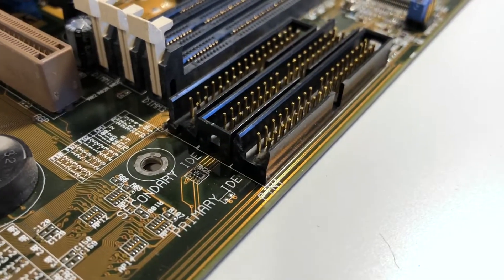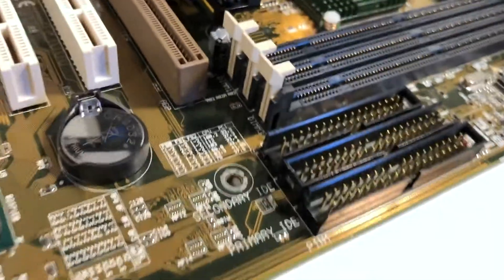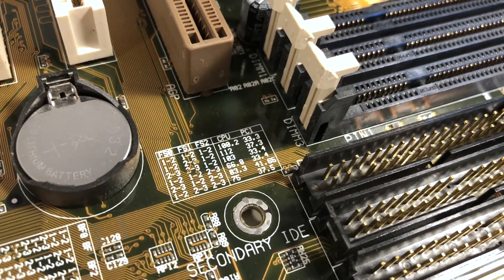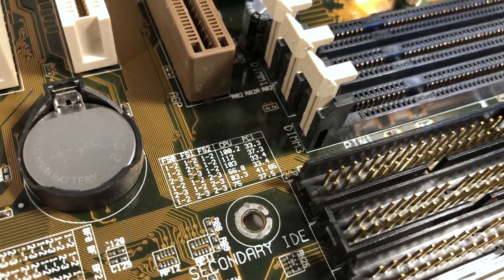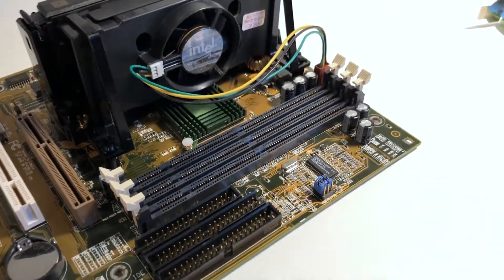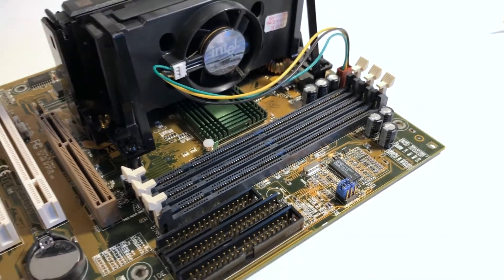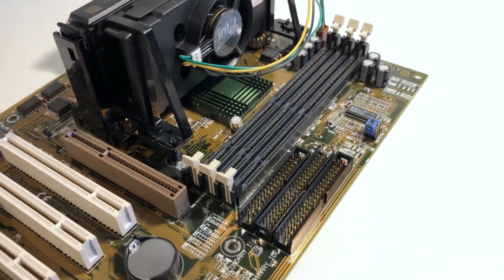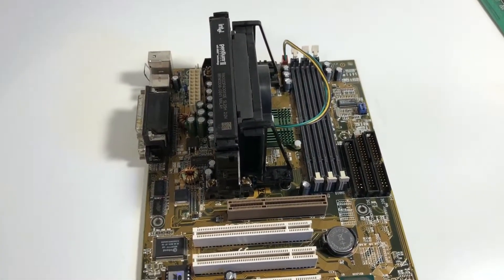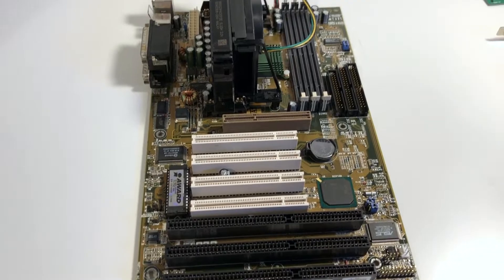You can see that on my board the connector housings got broken off, but everything works fine. There are some jumper-based frontside bus adjustments you can make if you're interested in overclocking — it conveniently tells you what the PCI frequency will be for those overclocks, which is kind of neat. The board supports three SDRAM slots and will take 100 MHz SDRAM, with a maximum of 768 MB, which is what the 440BX chipset supports. Overall a great board — this is the second one I've owned, and it was very well known back in the day for quality and reliability. All the caps are still original and in really good condition.